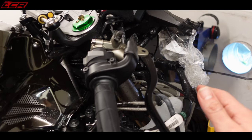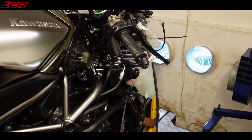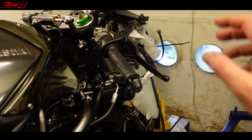So we're extracting the information from the ECU with a tool of choice. Yeah. And then we're putting the information into a hex editor, we're going to modify the data, and then use our tool of choice to put the information back to the ECU. What we're going to test today as well is a way of flashing it via the diagnostic port. Yes, we're going to test the diagnostic port flash today. Yeah, so we may not have to do this again.